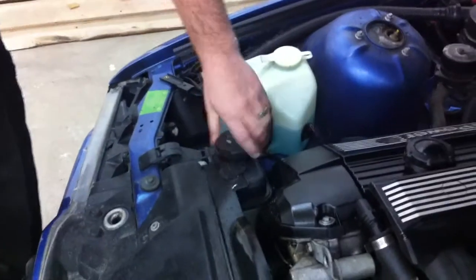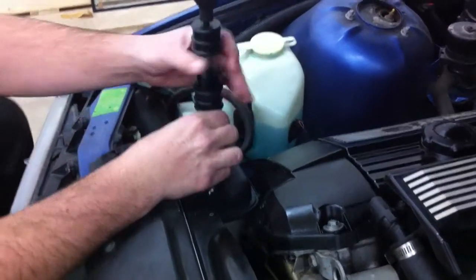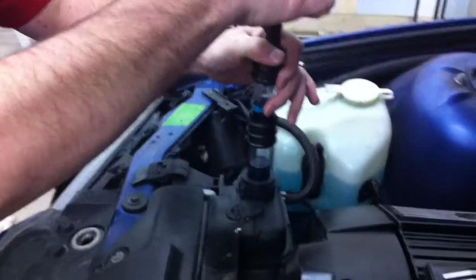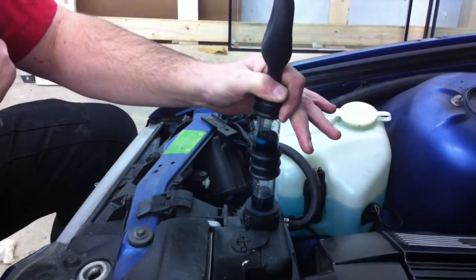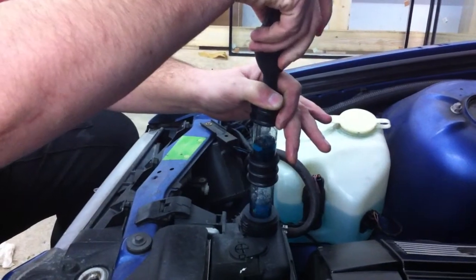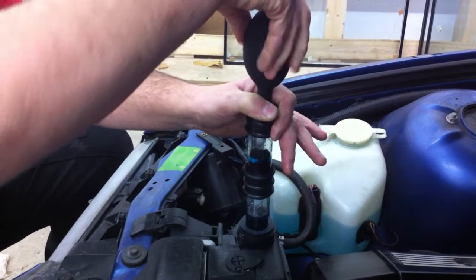The test calls for simply opening up your expansion tank. There's a small bit of pressure. It simply suggests getting a good seal and giving it three to five pulls, slowly, like this. There's three — we'll do one more. That's about all she's got for air.